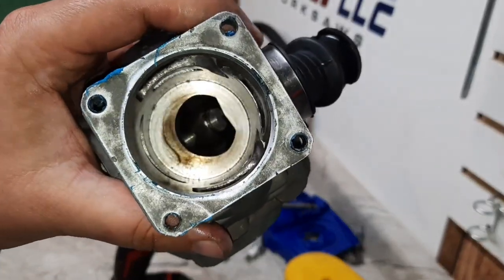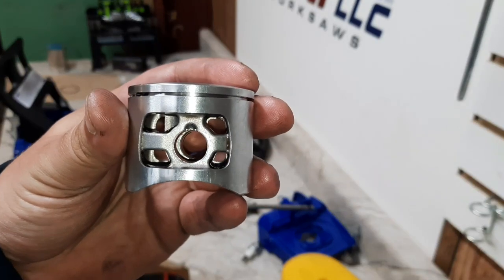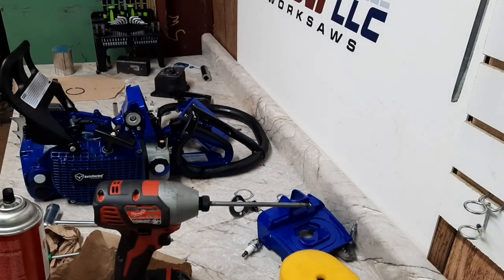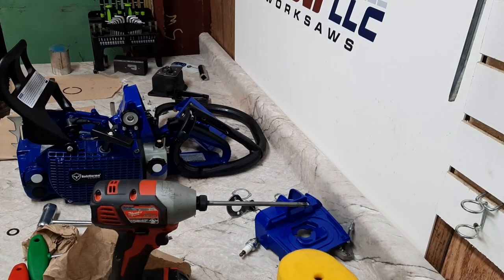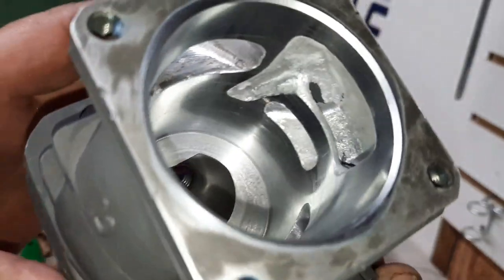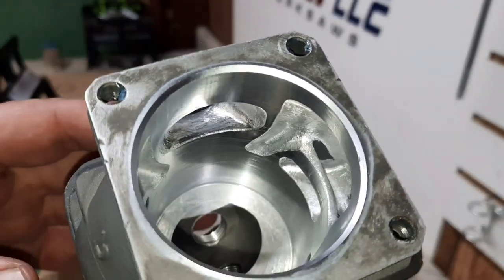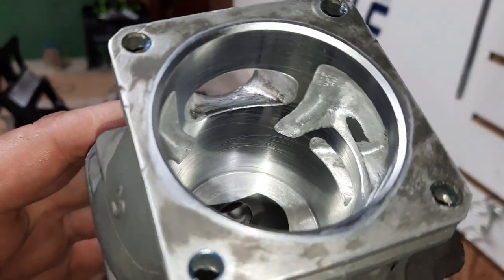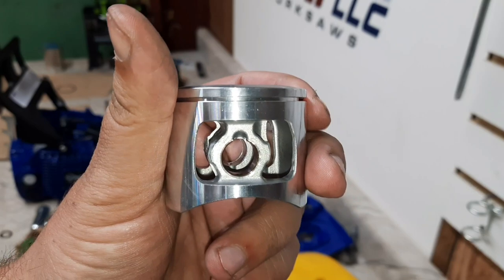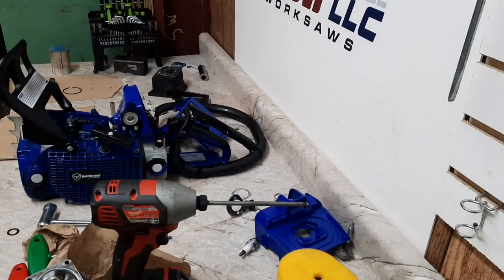See that little bit of run time, no new marks, piston looks good. I'm going to take these bars out, open those windows up to match, then I'm going to set the transfers at 116. I raised them and flattened them this time. Before, they were just as cast — they were staggered a little bit, started to open at 120, probably didn't finish opening until 124-125. I set them at 116 flat, slightly above the fingers, and left the fingers alone. Then I ground out the braces in the piston — that should flow a little bit better. Between that and the raised uppers, hopefully it gets the power where I want it to be.